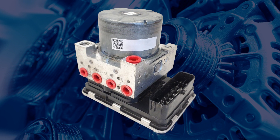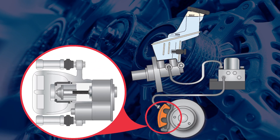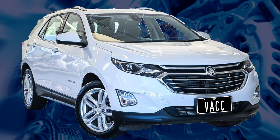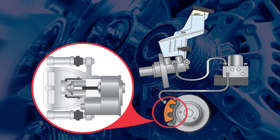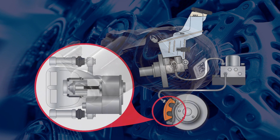The EBCM module monitors the brake fluid level and will abort the process if the fluid level is too high. If working on this vehicle and unfamiliar with its design, it will be reasonable to assume that the actuator has been retracted if the process has aborted, and the actuators have been audibly heard operating, and there are no warnings or errors given when the process aborts.